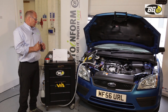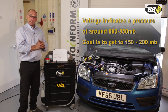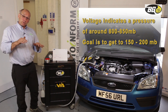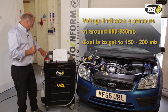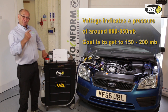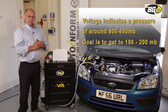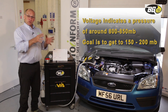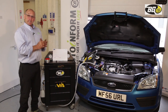Let's introduce the actual process now. David Misson is going to assist operating the throttle as we're going to change engine speed. We're going to start by loading the DPF at 1,500 RPM, matching engine speed and manifold vacuum, because we've now created a vacuum using the Venturi introduced into the air intake system. We'll take a short break while we set this up.